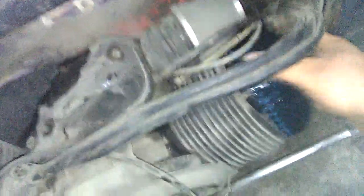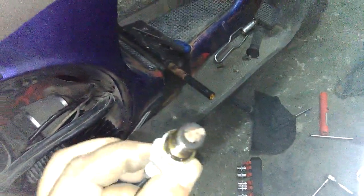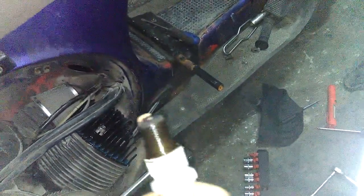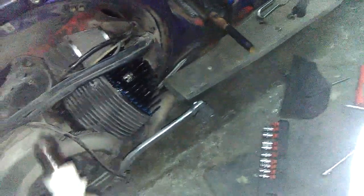There it is — slapping the new head back on with one hand. I'm checking the spark plug condition and it looks like a good burn: not oily, not too rich, not too lean — it's perfect. I put the bolts on, fit this on, and I'll start it up.